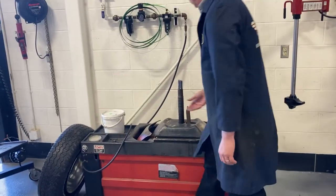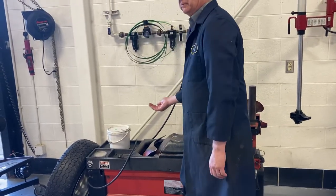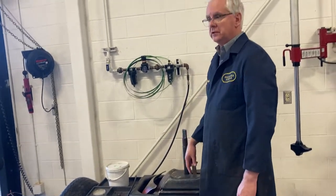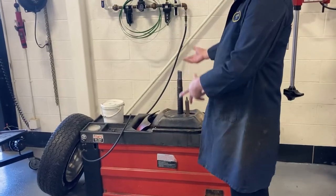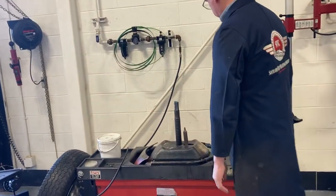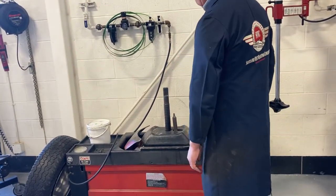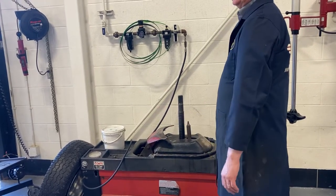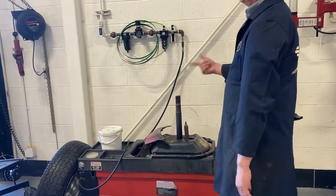Top bead, pushes this one up from the bottom to break that one free, and then the center arbor turns. Those all three things. And because it runs on air, it'll stay like that as long as you have your foot on the pedal. Once you release, the springs back here will pull it back. Questions